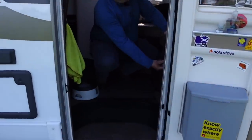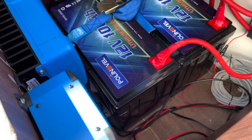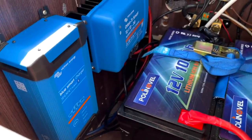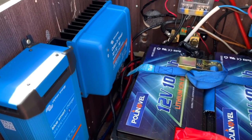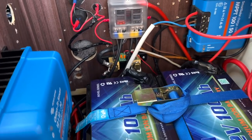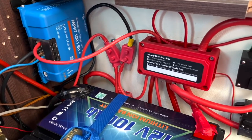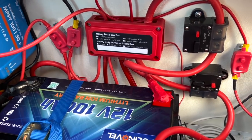As we walk in — Cooper's little storage cupboard, and the electrical cupboard. The van's got 200 amp hours of lithium battery, a 30 amp mains charger, a 30 amp B2B, and a 50 amp solar charger. It's all done by bus bars so everything's laid out nice and neatly. My system that I've installed is a separate wiring system to the van's electrical system — originally it came with an electro block system which I've integrated into mine. Everything's protected by fuses and breakers.